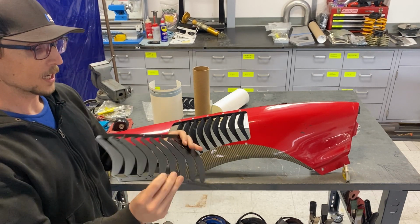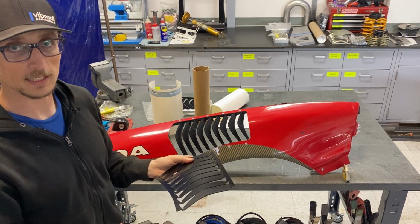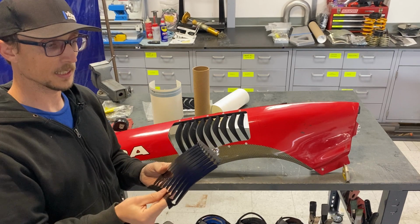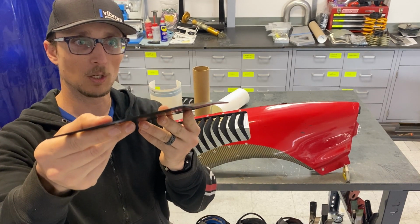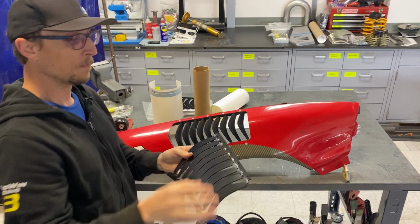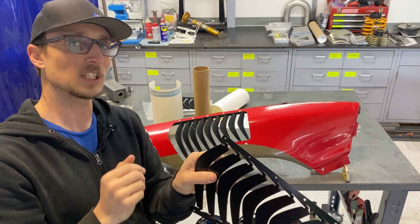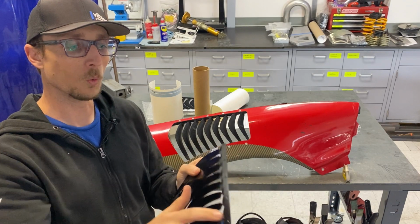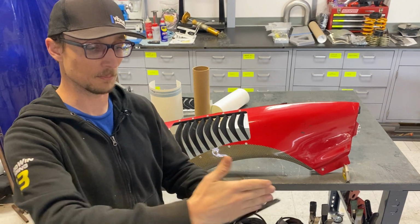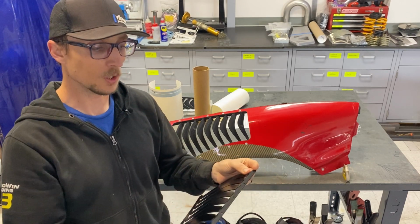Now, the louvers, as you get them, as they ship, are mostly flat. Unlike all of the other louver kits that we ship that actually are 100% flat, these do have one bend already done. If you're able to see it, hopefully it focuses, but this top flange, the flat one that goes on the top side here, does already have a bend all the way along here, and it's, I'm forgetting, 15 or 20 degrees. That is the one bend that, in my opinion, was going to be very difficult for people to replicate at home, because you're bending this whole wide length at one time. And so we took care of that for you.